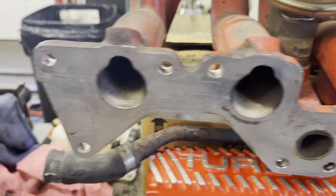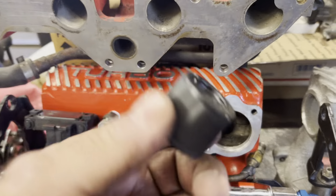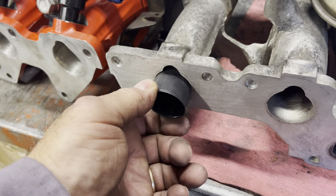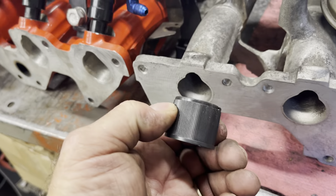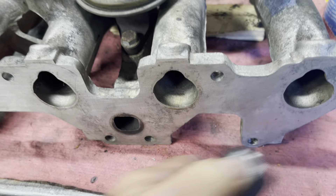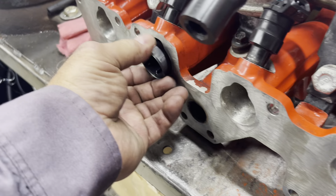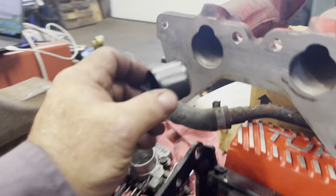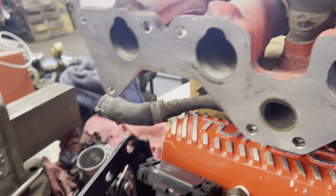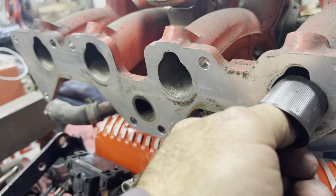More importantly, the ports at the cylinder head — that's where it bolts on. I have a Vernier caliper and I also did a down-and-dirty test using a cap off a brake cleaner bottle. On the MPFI intake, it barely goes in. The turbo stock one won't fit at all. But mine swallows it up past the injector boss. And here's a stock turbo one — it takes it in quite a bit of the way. This one has no injectors in it so it's apples to apples. You can see it's a larger opening.